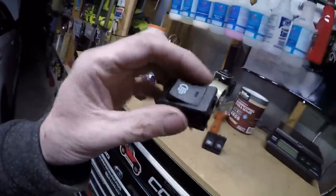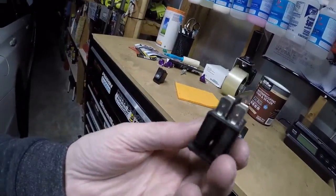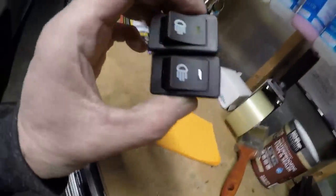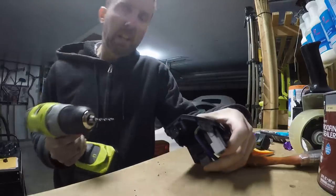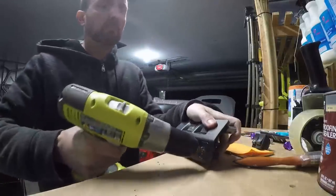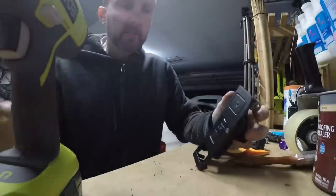I have a wiring diagram for the switches and it's pretty complicated — they don't even include directions, and everybody's pissed on Amazon. But I did find wiring diagrams: you use three of the four pins, and the third and fourth pin is optional depending on whether you want the light on all the time or only when power is applied. Obviously most people only want it when power is supplied. The hardest thing about this install is just figuring out where to put the switches. If you're afraid to take risks, why are you even living?